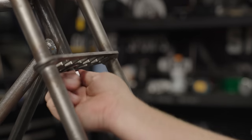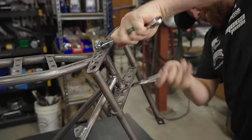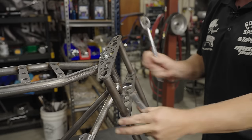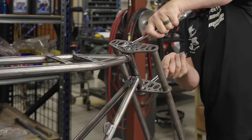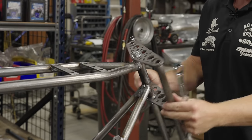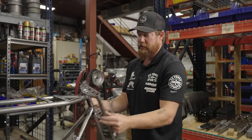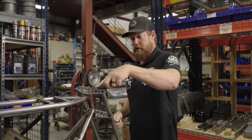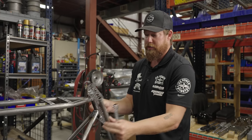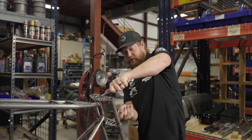This is a half-inch bolt, so you're going to use two three-quarter-inch wrenches. I go until it's tight and then loosen it from there — you don't want to feel any drag in this. If you feel drag, you're going to feel that when you're cornering. They will loosen up a little as you ride. You want it nice and smooth.